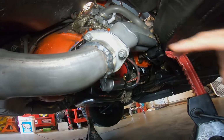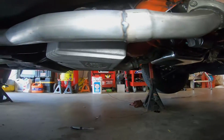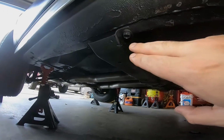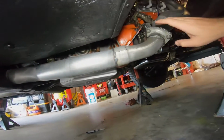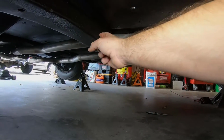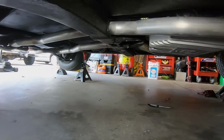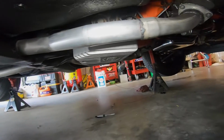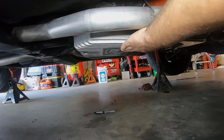And we're not going to pull the engine out to do this. That is not going to happen. So the next best thing, transmission. Now fortunately this Corvette has a removable cross member here. So we're going to have to take the collectors loose. We're going to have to take the cross member loose. And then once all that's out of the way, the drive shaft's obviously going to have to come off the back of the transmission. And then after that, bell housing bolts, and then my transmission jack on this really sturdy transmission pan that Mikey put on here.